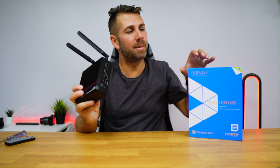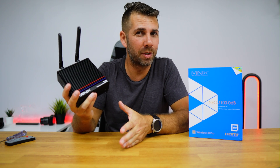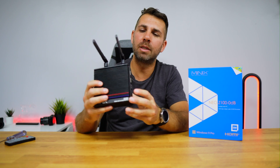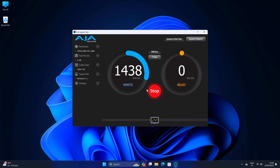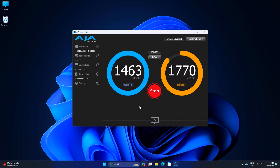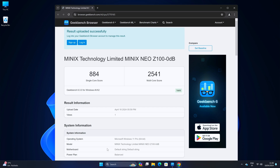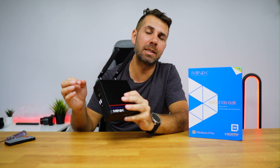If you want to see the accessories that come inside the package, go to the end of the video where I share a little unboxing. Now let's look at some benchmark numbers for what the N100 is able to achieve. All tests are done with the stock components — no upgrades. For disk speed, we were getting 1500 megabytes per second on writes and 1770 on reads, which is great for this kind of machine. In Geekbench, we got 254 on single-core and 884 on multi-core. Cinebench: 52 on single-core and 164 on multi-core — in line with other N100 results.